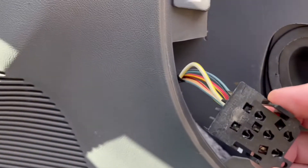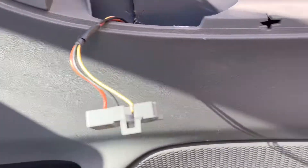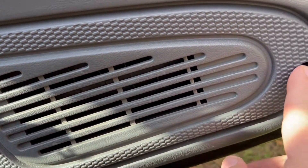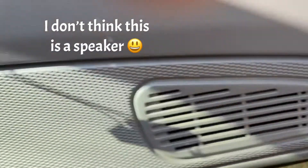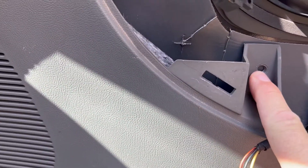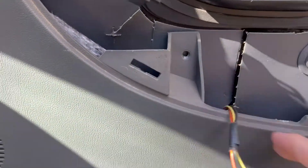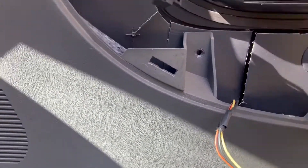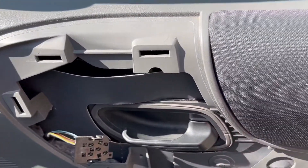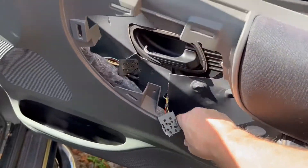You see the connectors are flat and they've only got the lock on one side. Once that's done, you got one more screw hole down near your speaker, bottom right-hand corner of the door when the door is open. And you got one right here, just right below the door handle. Take those two out and the door panel itself will come up on you and come off.